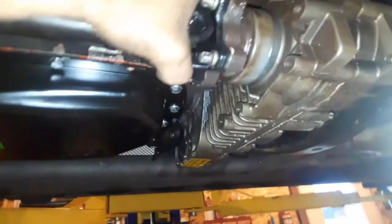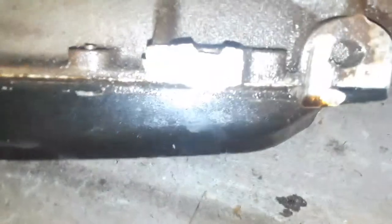I'm making a short video about a 2006 BMW X3 transmission job. A friend's drive shaft for the 4x4 broke, and that damage hit the transmission. It also bent the oil pan. When a new shaft was put on, nobody noticed the bent oil pan, so the transmission leaked completely, burned the clutches, and the vehicle stopped moving.